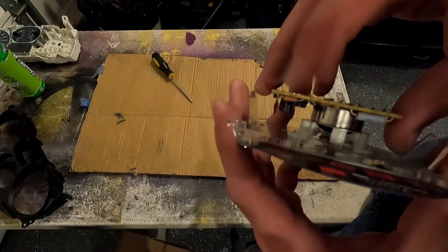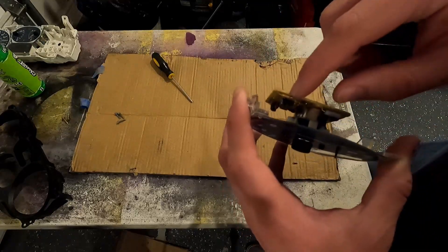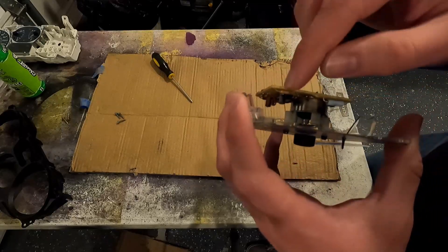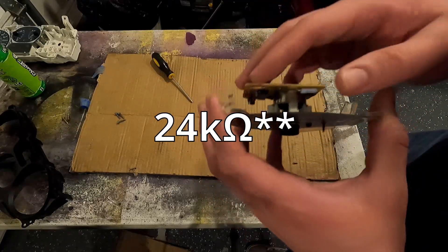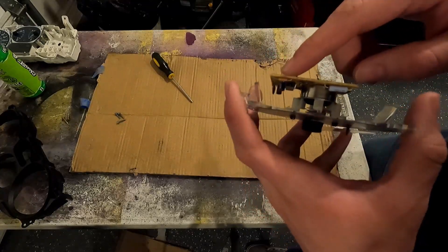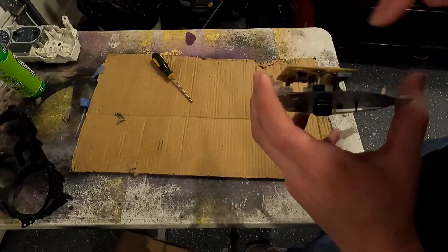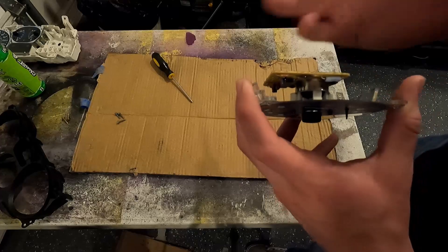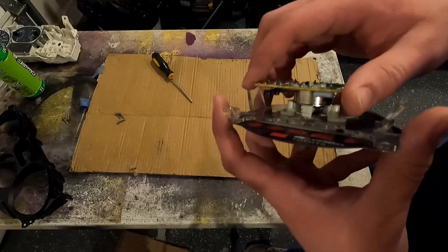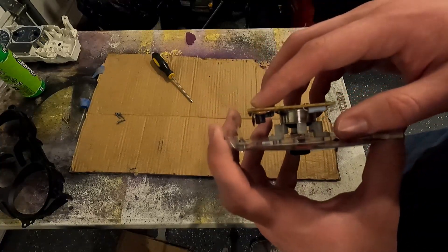In this case, this is a 43 kilo ohm resistor. This varies depending on application — I think it has something to do with the coil pack strength — but we need to replace this with about 24 kilo ohms. I could replace this with a 24 kilo ohm resistor, or I could add about a 60 kilo ohm resistor in parallel. This isn't super critical; it doesn't have to be 100% on the tolerance. There's a pretty wide margin — as long as you're between about 24 and 27 kilo ohms, you should be fine. I'm going to replace this resistor since I have a bunch laying around.